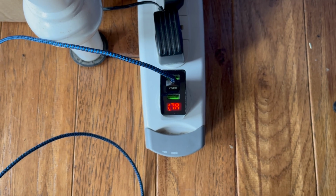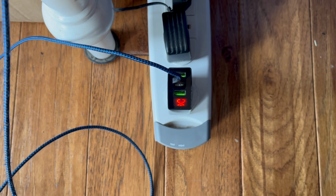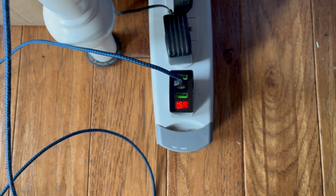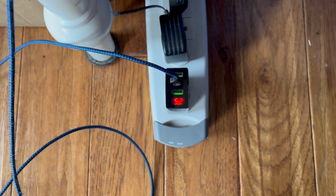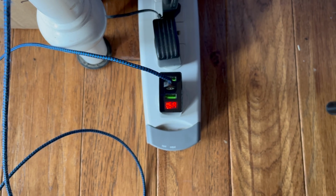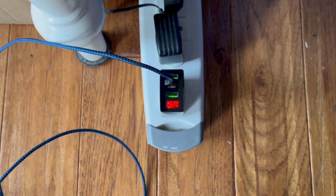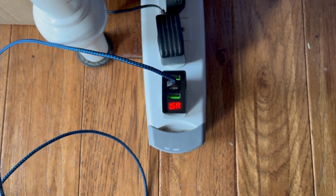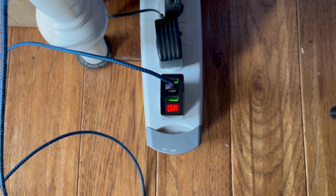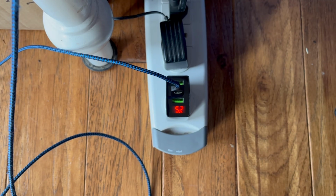So this is one potential solution. This does not work all the time, but in certain instances, I've seen it numerous times where people bring in iPads that won't charge and they need the charging port replaced. However, if it's powered off, you will see the amp draw increase and it will actually charge the iPad. Mostly with 5th and 6th gens. I see this with 5th and 6th gens most.